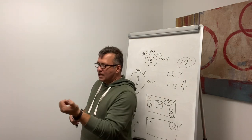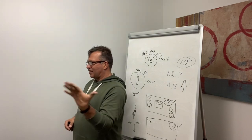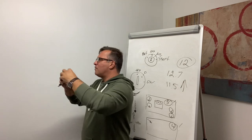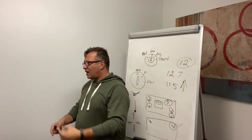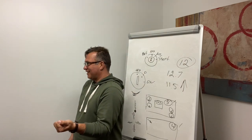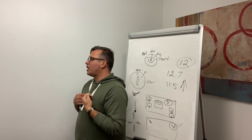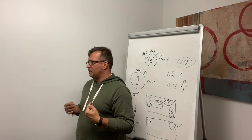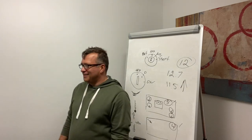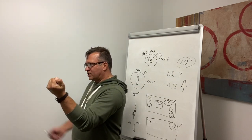But what can happen if you didn't wait until it starts spraying? You will release it, then push it again, hold for 3 seconds, release it. Then again, you will get air bubbles in the line. If you got air bubbles in the line, now you need to push it and hold for a minute before it starts spraying. So make sure you hold it. I will check it, I will make sure there is windshield fluid in it before your test, but you will forget. I can forget as well. That's never happened before, but I do. So push it and hold until you see it spraying. Once you see the water,